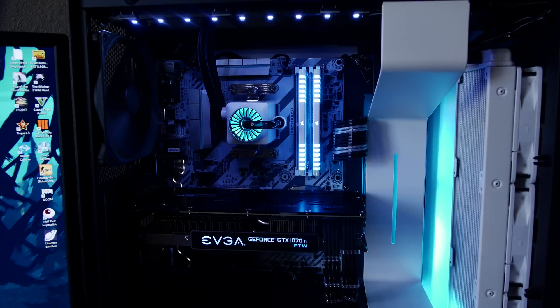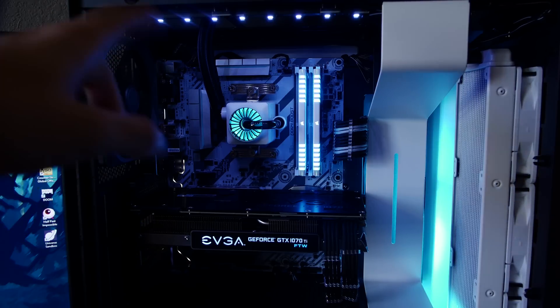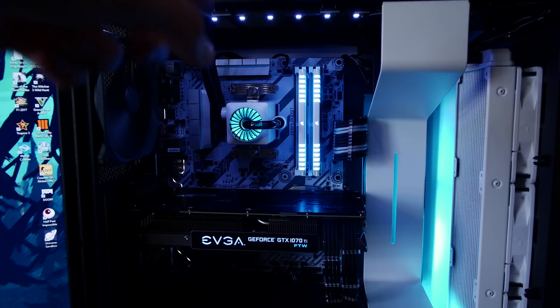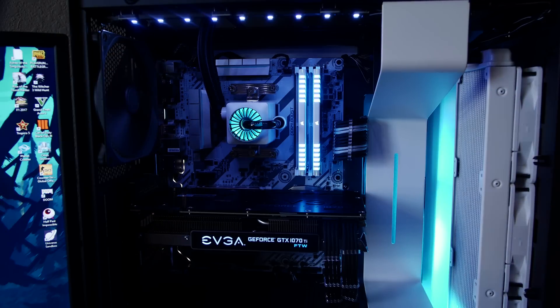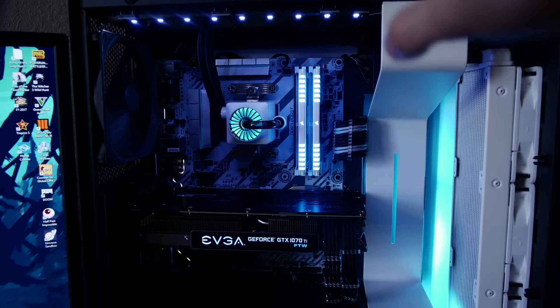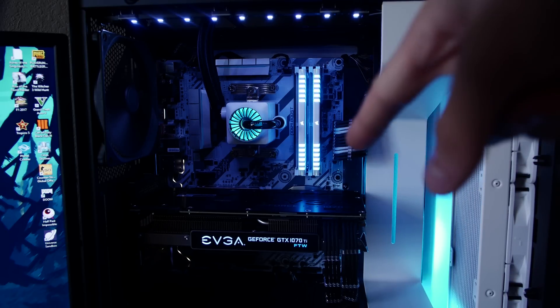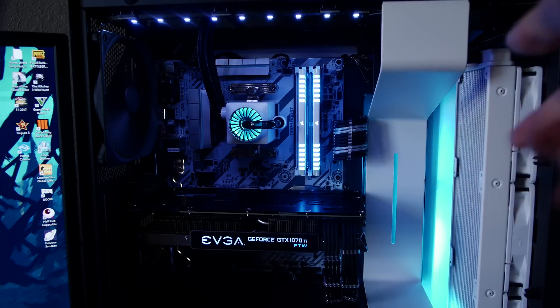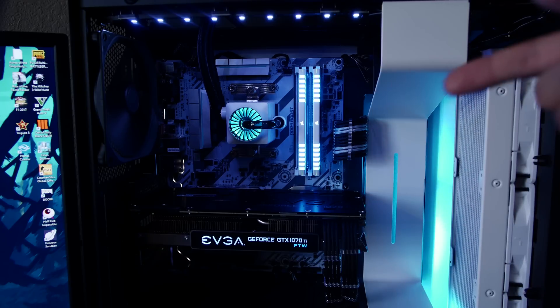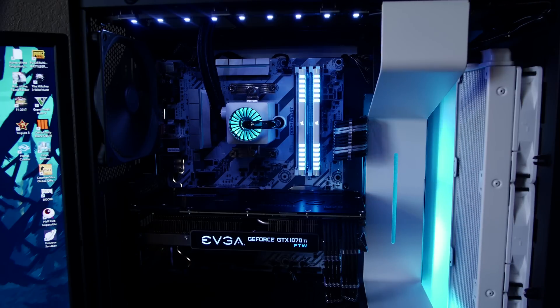What you're looking at now is the MSI B350 board paired with an EVGA 1070 Ti — the same card we used to benchmark the 2700X originally. But the CPU in there this time is the 1700X, a Summit Ridge CPU. This is very important because unless you buy the motherboard brand new, and even then you might not get the most up-to-date BIOS, you're going to need that updated BIOS to initially boot into the new Ryzen Plus CPUs. Out of curiosity, I actually tested the 2700X straight up in here without the UEFI update, and all I got was a black screen. Everything looks functional, but you're not going to get an official POST until the UEFI is updated.